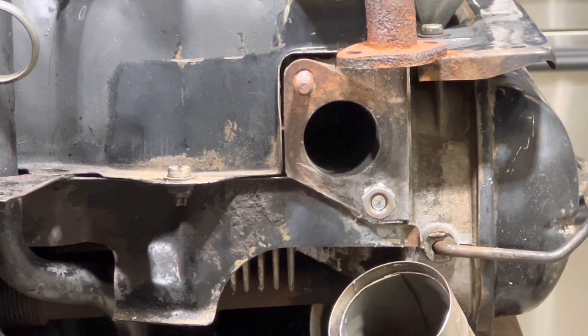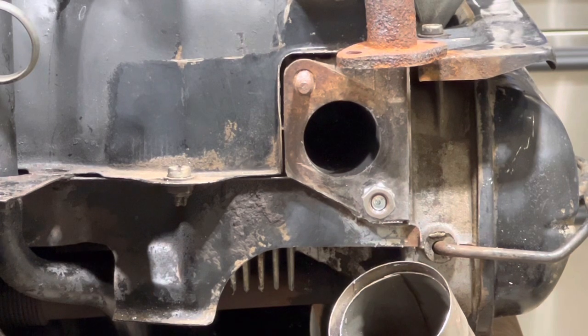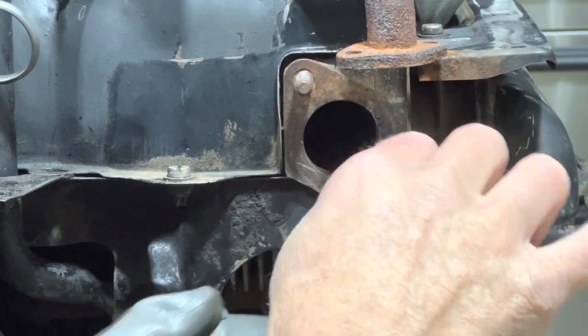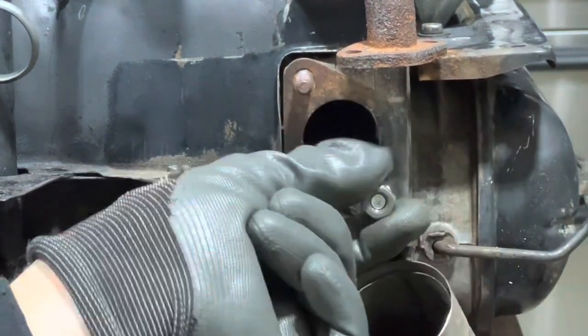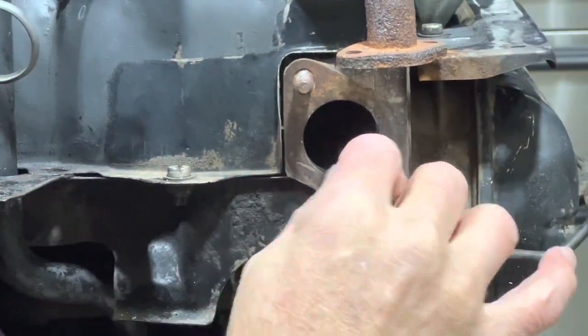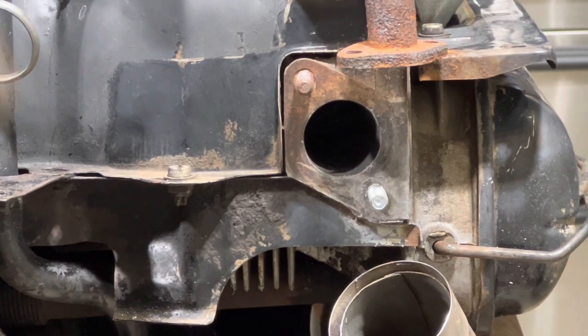This is a temp fix — it's not going to be a permanent fix. I intend to remove that Permatex Liquid Metal in the near future and re-weld that with proper stainless steel rods by TIG welding it. It will be much easier when the head is out and I can preheat it in an oven. I'm pretty certain that when I TIG weld it, it's going to be very solid. So I don't really see a need to do something else at this moment.